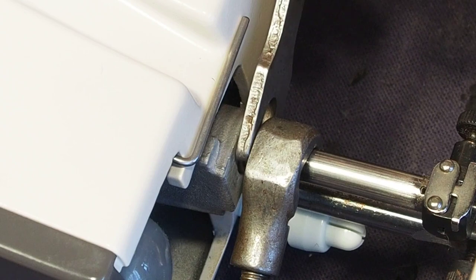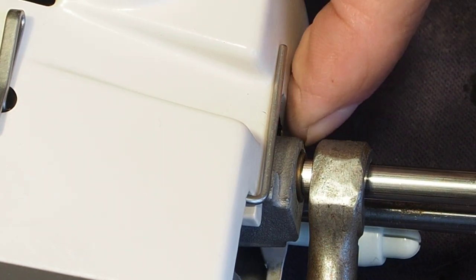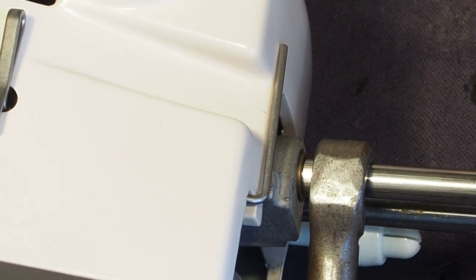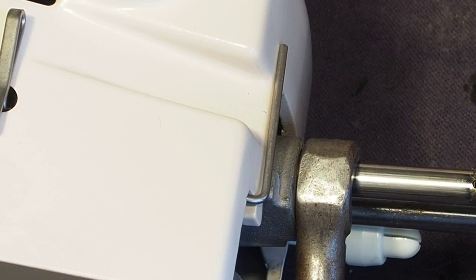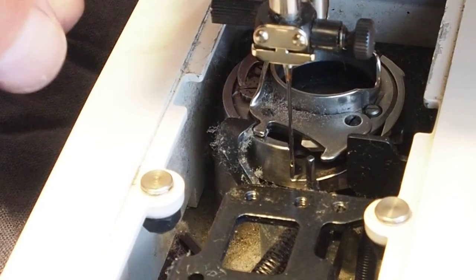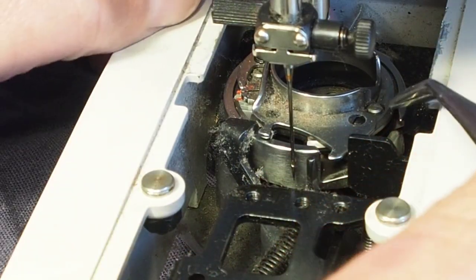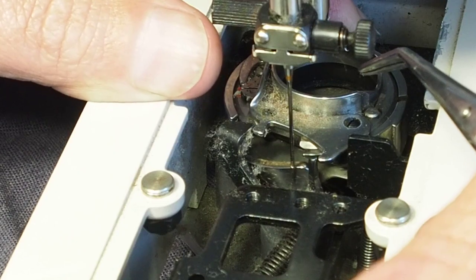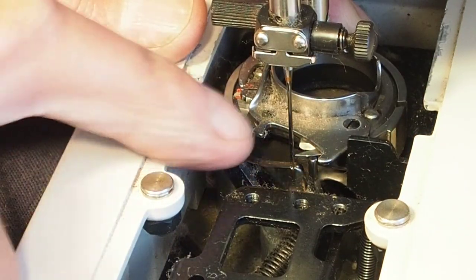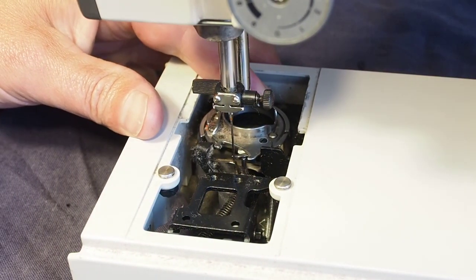And then when you remove this gauge, you know that the distance between the clamp and the lower end of the bushing is 2.4 millimeters. So when you turn the machine in operating direction, just to close the gap up, you know that the needle bar has risen 2.4 millimeters. And then without moving anything, we bring the hook point, which you can see around here, and bring that around until it's just behind the needle. The point of the hook should line up with the center of the needle. So once we have that lined up there,